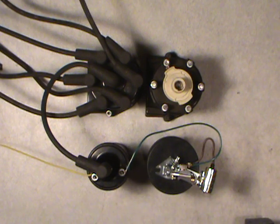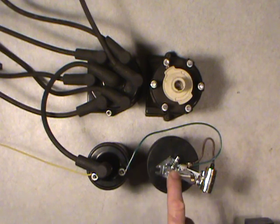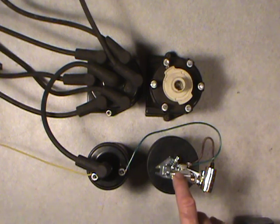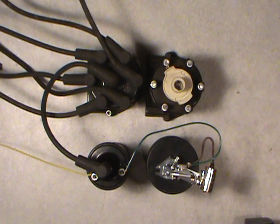In 1975, General Motors came out with a high-energy ignition. It had a very large distributor cap, and they had an ignition module and everything in it. This is the basic setup, and it was very easy to understand because it was mechanical — you could actually see what's going on. When they went with the electronics, you can't see what's going on inside those modules or chips. But this is a basic understanding and the best way I can show you just what's going on with your engine — as far as what goes on with firing the spark plug and the timing of it. In future videos I'll try to get into the advance mechanisms, and if I can get hold of an actual distributor that this point set fits into, then it would be all that much better. So enjoy, have yourself a nice day, and bye for now.